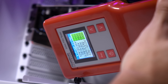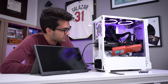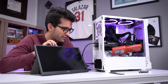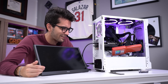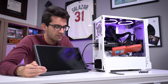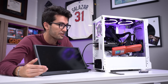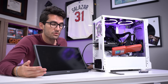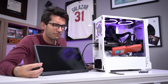At this point, I am definitely leaning towards a bad motherboard — maybe not a dead motherboard. The system does power on, but it does not send a signal out through the graphics card. There's got to be an explanation for why we can't power on this motherboard via any other means than with the inline PSU tester. Front panel jumping does not work. Using a mechanical button doesn't work either. That's why I think there's something finicky going on with the motherboard.